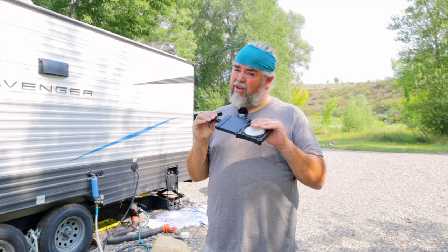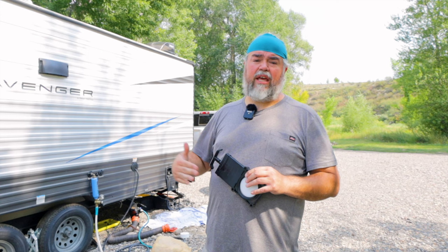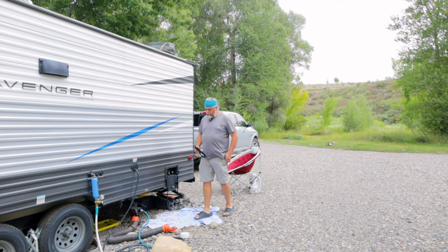To help make sure that I can get my black tank properly cleaned while this valve was getting stuck, I added a second gate between the hose. I've got a piece that plugs in that I can hook a hose to so I can do a flush — which I'm doing right now. And I added another gate below that so the water can fill in there and stay in there, really fill up that tank. My goal was to get the water in the black tank to go as high up as possible into the toilet area.